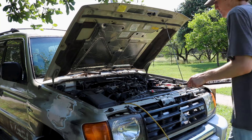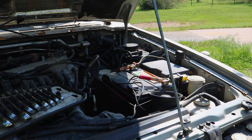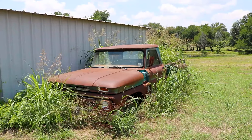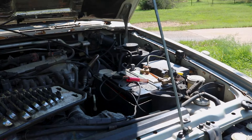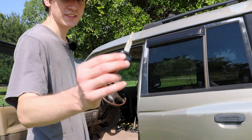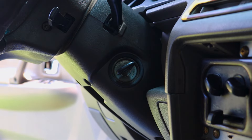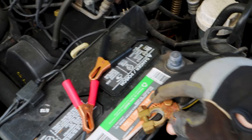We'll need to disconnect the battery before we can begin — it'll essentially trick the car into thinking nothing's happening. I forgot that I actually took this battery out to put in our '65 Chevy because I didn't have a spare on hand. Now with the car disconnected from the battery, we go inside the car, put the key in the ignition, turn it to the full on position just before start, close the door, and then reconnect the battery.